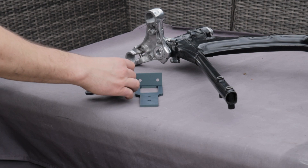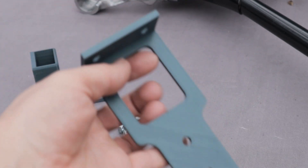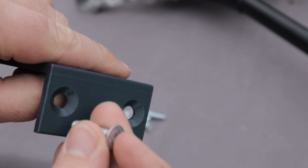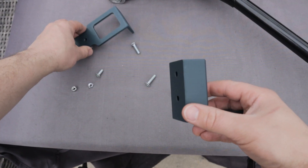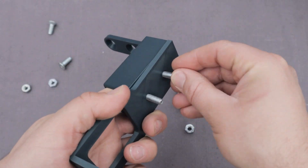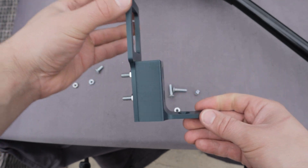We're back outside and these are the final parts to this assembly. Part one is the CDI holder, looking great in the daylight, and part two is the back supporting bracket. We bolt them up with countersunk fixings — six millimetre bolts — and once in place they sit flush or below flush with the surface. These two parts line up when right around and drop together. The two front holes act as access ports, and then you can bolt this thing together. It's important to note that the bolts will be long for now and cut down once finally installed.